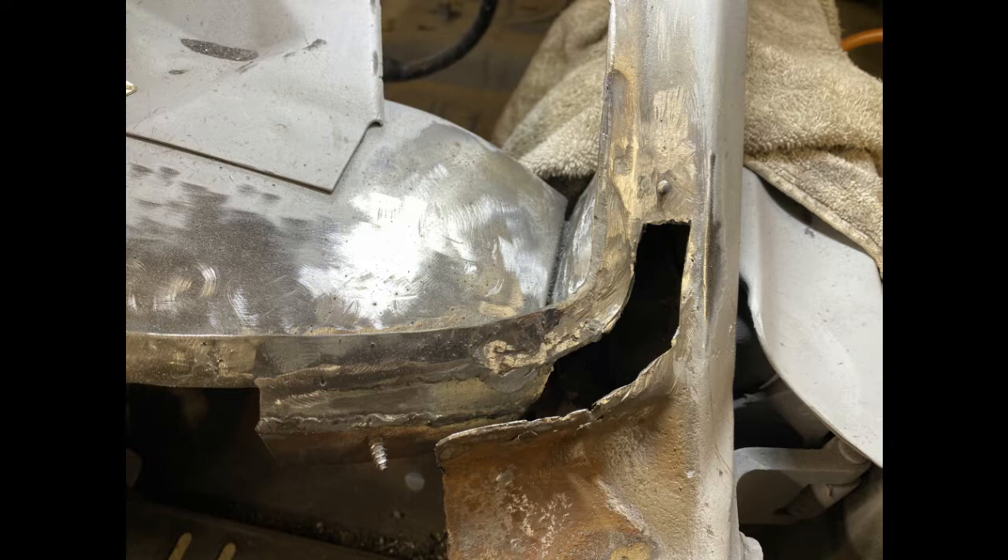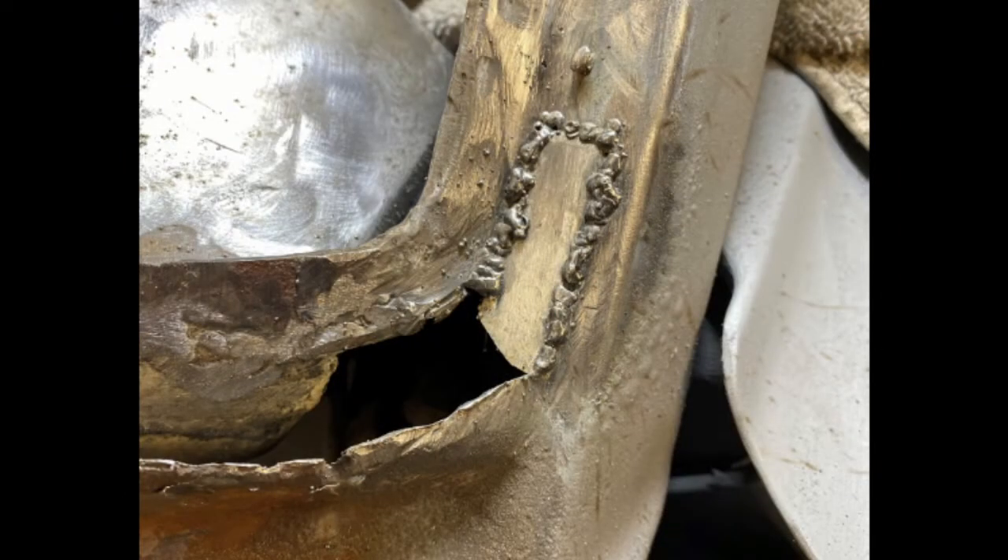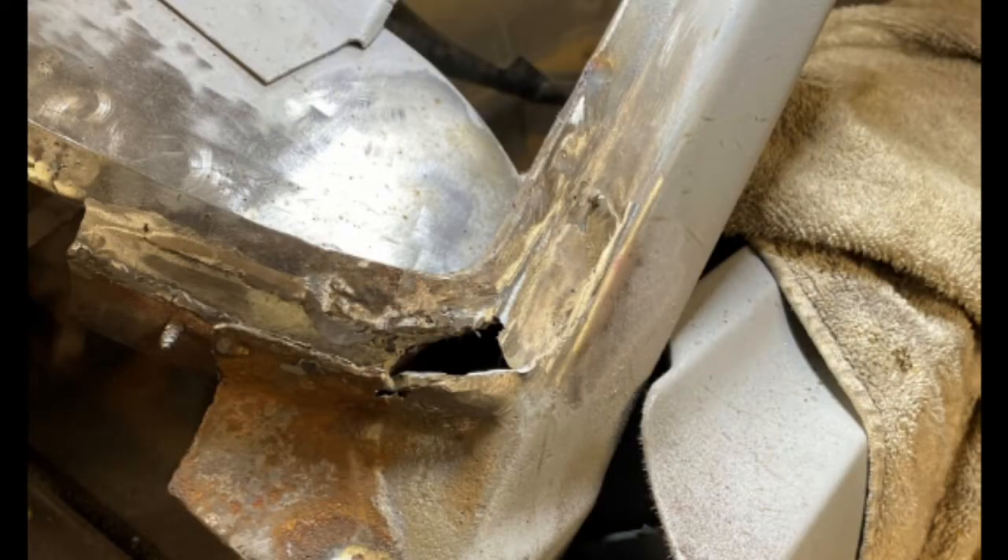Now I'm going to start on the slot to the right. I cut a small piece of sheet metal to fit in the slot — it fit pretty snugly but there was a small gap around the edges — then began tack welding it in place. Those welds aren't real pretty, but it was also the start of my learning curve, and we all start somewhere. I also had not yet learned that I could go to a thinner wire on my welder. This also ground up pretty clean, as you can see in the next picture.